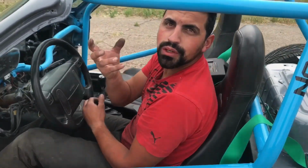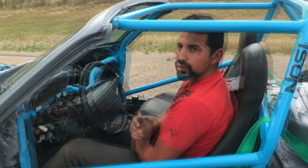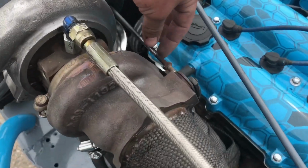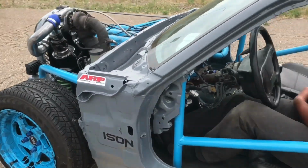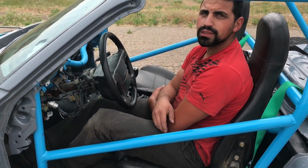So it's just idling way too low. It's a lot of the boost problem too. When you disconnected that, how much of those threads were in? About 4 left. I think no matter what, I could be wrong, it's got to take 14 psi to open that wastegate.